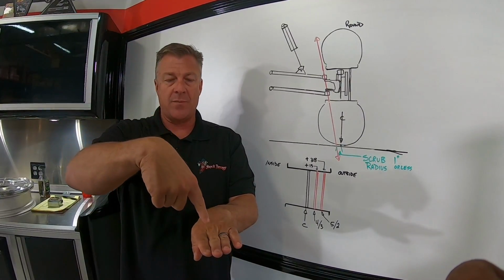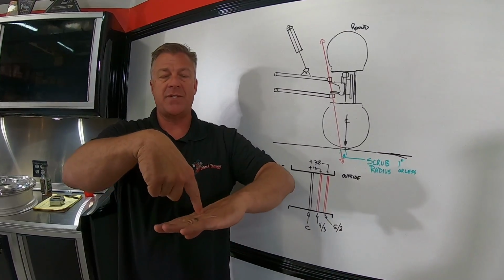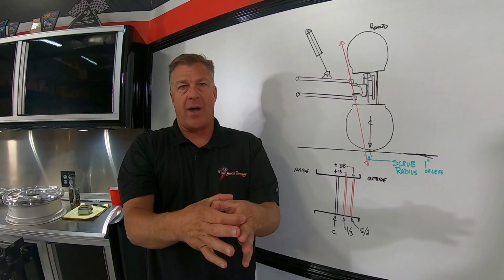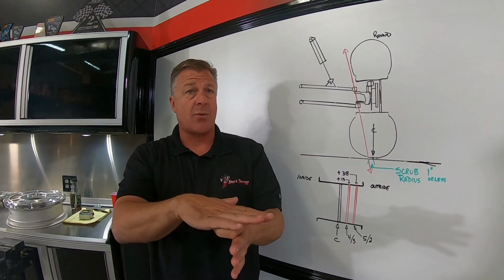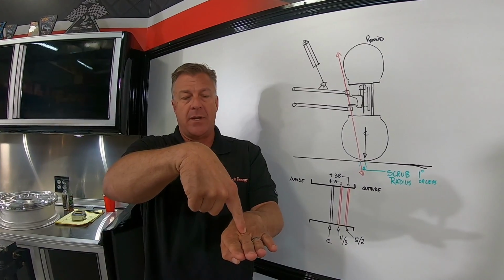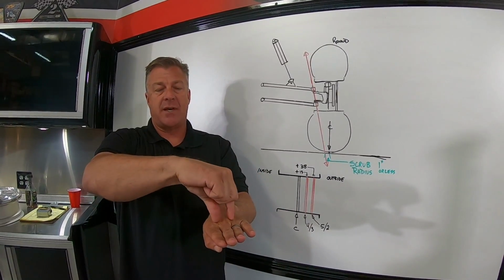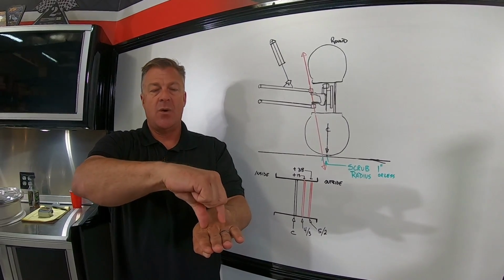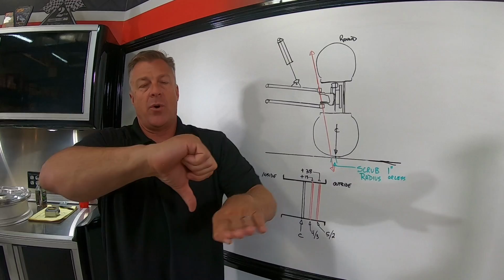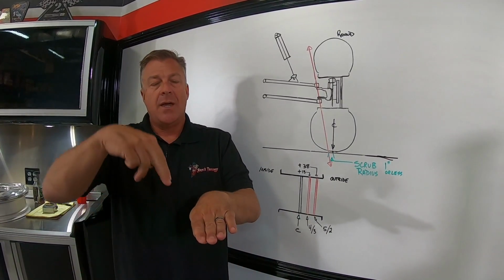If that pivot point comes down to the center of the tire and you turn the tire, it's going to pivot on the center line of the tire and leave a perfect round little spot on the ground where the tire is moved around or scrubbed. If that pivot point, kingpin inclination angle, is inside or the tire is moved out and you've got, say, a scrub radius of about 2 inches, when you turn the tire, it actually turns the tire around that pivot point, leaving a half moon or a circle of rubber on the ground.